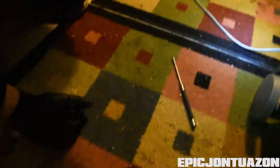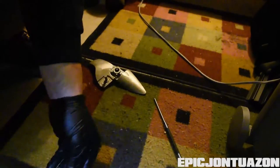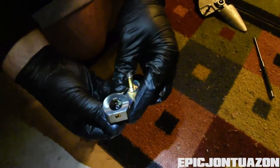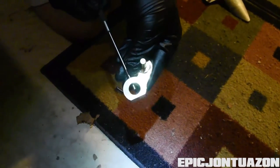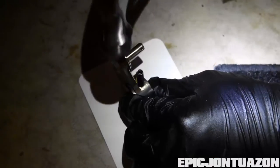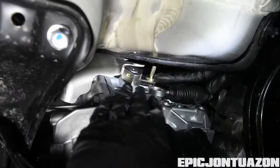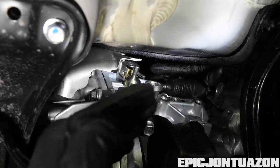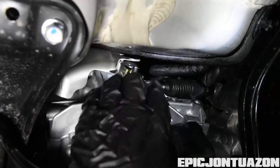This is the orientation that it was in — you want to match that orientation with the new one. Perrin conveniently left one side flat so you can start the pin. You want to tap it into place just far enough so that it's not sticking into the center of the hole. The trick is that you want the flat side of the adapter facing the edge of the shield — Perrin cut that flat side so it wouldn't bump into the shield, allowing you to slide it up and onto the pin. So the roll pin is flush in, and now all you got to do is reassemble.